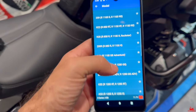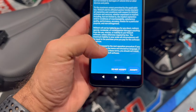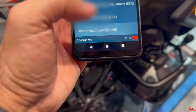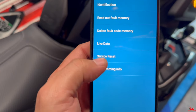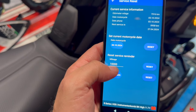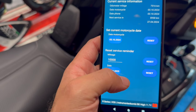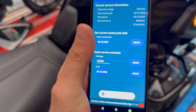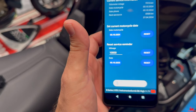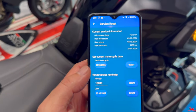Just to show you again — you go right into it and then go to the instrument cluster. Accept instrument cluster. Then you see service reset — reset reminder, 10,000 miles — and set the date to 3-10-2025. But it shows 'Not available in light version.' I need to troubleshoot this and come back.